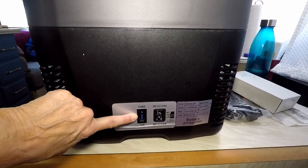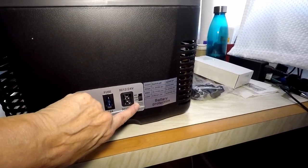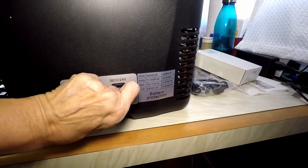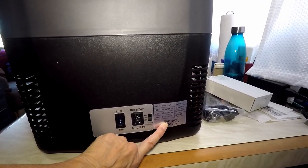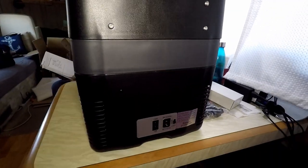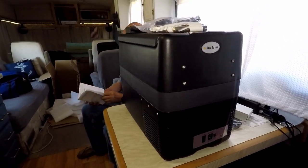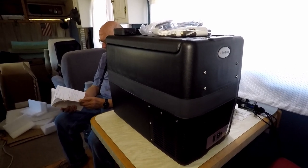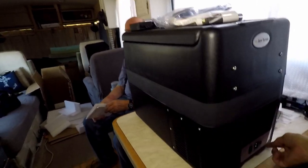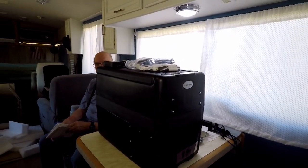It does have a 15-amp fuse that's easily accessible where you plug in. This switch here is battery protection — when you're running it in your car or on a regular 12-volt system, whether lead acid or AGM, you can set this to control how low your battery power can drop. If it gets too low, the fridge will automatically shut off so you don't totally kill your batteries, which is a very cool thing. One thing to note: if you're running lithium batteries, that switch kept shutting the fridge off in another reviewer's experience, even though lithium can be taken down a lot lower. So if you're running on lithium, keep that in mind.